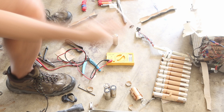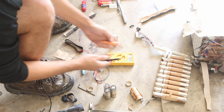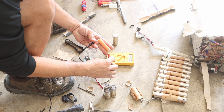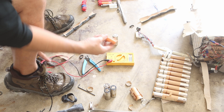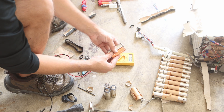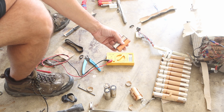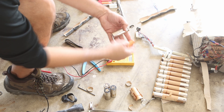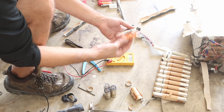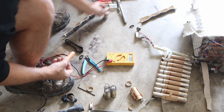You guys know in comparison this is what's called an 18650 cell, and these I got from laptops and stuff. So I can take a reading from here — 3.78 volts. Most of these are 3.6 volts, so I use these for little projects. And if you look at the size, things have progressed over time — this older cell is much heavier with less energy in it, and this one is much lighter and smaller. I don't know if I'm able to build a battery pack with this — I'm going to have to figure that out.